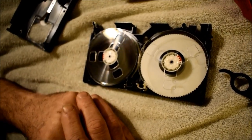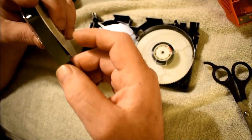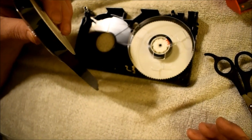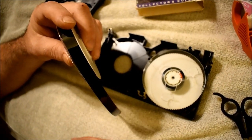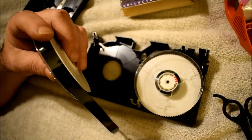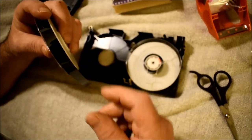You can also clean up a VHS tape that doesn't play — one that has a layer of grime, film, or scum from moisture, heat, or dry rot on the actual ribbon itself. It's microscopic, you can't really see it, and it causes nothing but static when playing. But if you play the same tape five or six times, put it on repeat, turn the TV off and go to sleep, and wake up the next morning, the tape is actually working. So before discarding a VHS tape, play it several times and let it clean itself.